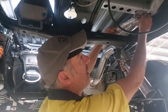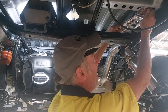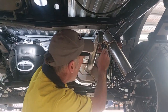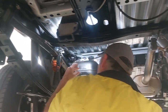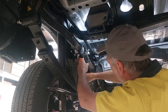Now we've got that up in the air, we'll have a look at what we have to remove from under the Ranger. First thing is we pull out this heat shield — that's pretty straightforward, just a little 8mm bolt. Then you take off this bracket here which holds the handbrake cable, and you keep that bolt because you're going to reuse it. And then on the passenger side you remove the brake bracket, and we give you a new 30mm long bolt for that.